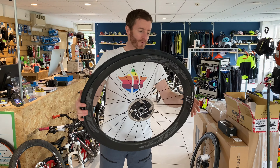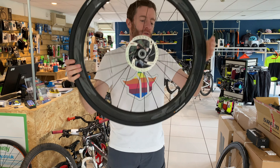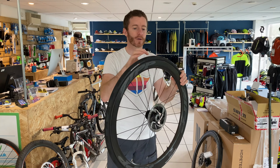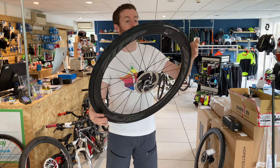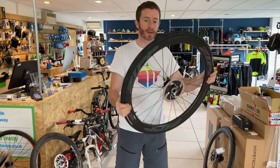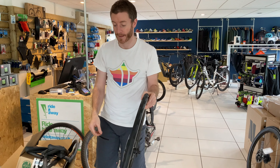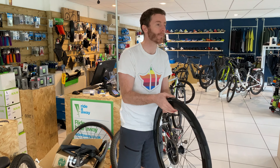Once you've completed, give it a good shake to get that sealant round. This is really super important if you're not going to ride the bike straight away, because what will happen is the sealant will stay at the bottom and all this could dry out quite quickly because it hasn't got a good coating yet. You'll come to it in the morning and it'll be flat with sealant all over the floor. The best way to do it is ride it pretty much within a few hours of converting it. If not, keep giving it a good shake. Take the wheels off and lie on each side, then a couple of hours later just turn it round and switch it over — just to make sure everything is fully coated.